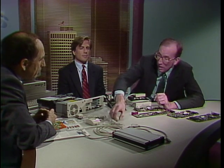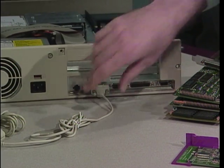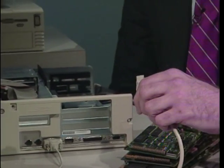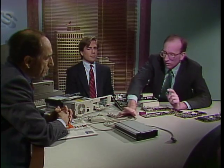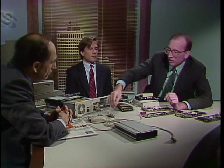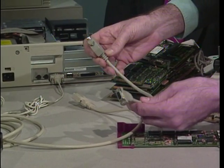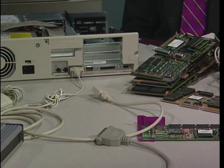What about the serial port and parallel port — what do you do with those? The serial port, often called the RS-232 port or COM port, is used primarily to connect mice if your system does not have a mouse port. Another popular use for a serial port is an external modem — here we can connect into COM2. You may find when you get your external modem that it has a slightly different connector; this is a 9-pin connector. If that's the case, you need an adapter, also sometimes called a pigtail, with a 25-pin connector. A 9-pin and a 25-pin are really identical. A parallel port actually operates at a higher speed than serial ports, and they're used for printers and scanners.